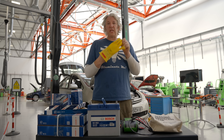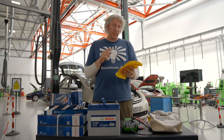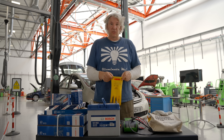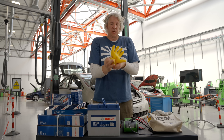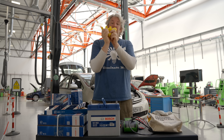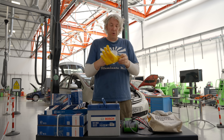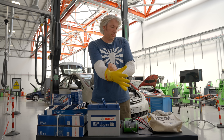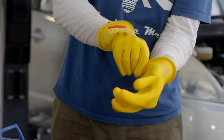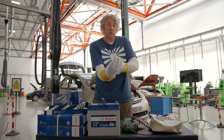The first thing I need to do is make sure I've got my right PPE gear. These are Class Zero 1000 volt gloves and they even come with a special leather protective outer sleeve to make sure they don't get damaged. To make sure they're not damaged, I need to check the date — which is written here on the glove — it's in date. The second thing I need to check is that the glove has no splits or holes, so I'll do a special test using air pressure — spinning it round until I've got air and using my eyes or the sensitive parts of my skin to feel if any air is leaking out. If there's a leak, it means there's some kind of hole and therefore metal or some dangerous part of the car could get to my skin. Having proved that's okay, I can pop that into position and put on the glove as well.